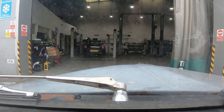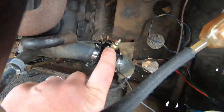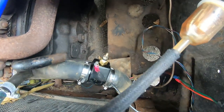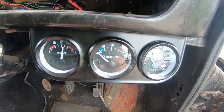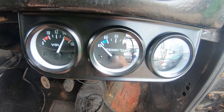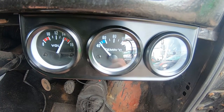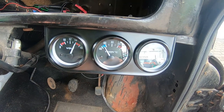We've still not got any temperature. Well done to those of you who have been screaming at your phone, computer, or TV screens - you probably pointed out that little screw there. It is needed - that's how the sensor grounds out. So I've loosely grounded it out there. It's not a cheat - I did actually know about that, because I've got that same block in the midget. So that's my excuse. But if I do that now, you can see that we are just over. If I start her up, you should be able to see it rising. And all of a sudden she goes off very quickly. Yeah, that's all good - we're warming up pretty quick now.